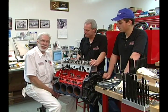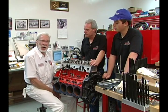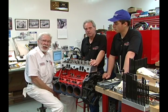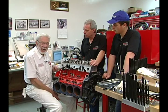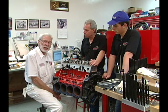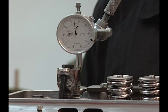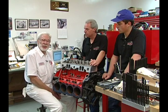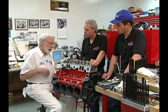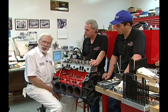I'm 75 years old. But today we're going to look at something that's pretty much misunderstood by a lot of racers. I'd like to talk about valve geometry, rocker arm, and push rod relationship. On the engine, we have mounted a production type of stamped steel Chevrolet rocker arm, but instead of being a 1.5 ratio, this is a 1.6 ratio. I can change the ratio of this stamped steel rocker by effectively changing the angle of attack on the valve through the center ball stud.